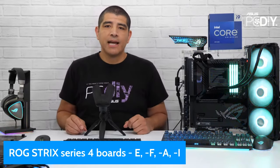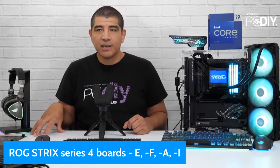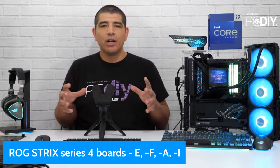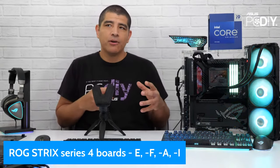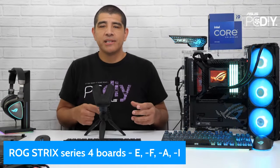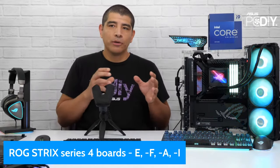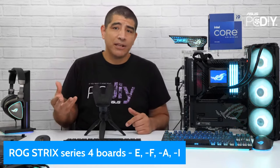And the great thing is that that is based off of hundreds of samples that we test internally with many different types of CPU cooler configurations, so that we can make sure that we align your actual overclock with your system's cooling performance. The better the cooling performance, the better the overall core overclock that you can have. And we also have sliders that allow you to go for either more aggressive overclocking or more conservative overclocking. And you can, of course, use that as a baseline before you go into manual tuning.